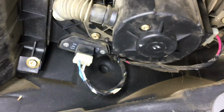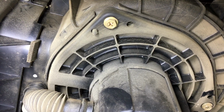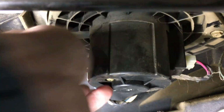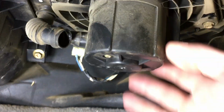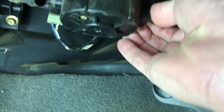In the car, we are passenger wheel well and just look up. Interestingly enough, the bolts that hold this on are actually Phillips or 8mm, so we've got 3 of those to undo. But the connections we need to actually physically undo from the motor before we pull it is the hose that I mentioned for cooling, which isn't really held on except for friction. So you can just wiggle that back and forth until it comes off. And then, as we did earlier in this video, on this plug, there's just a press in on the side and it'll let go.